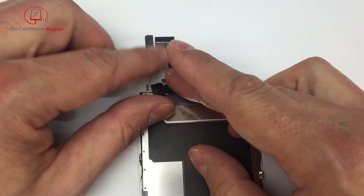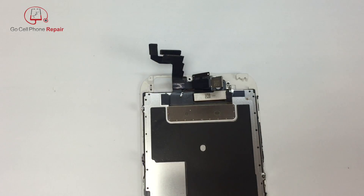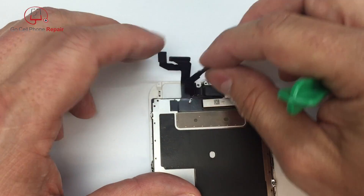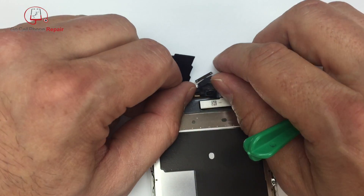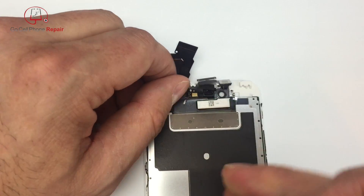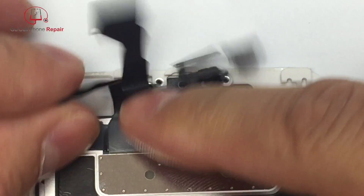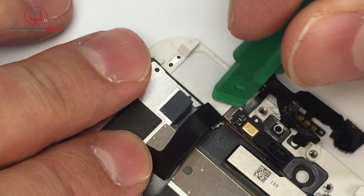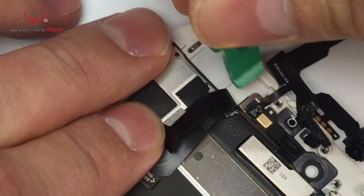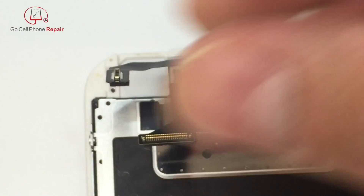Now you can fold the camera over to the left-hand side. Do be careful with these cables. There's an earpiece right below that, so you can take the speaker out, but the next steps require care because the adhesive here is a little bit tricky. Peel it over to the left-hand side and maneuver the cables to get to the microphone, which is that little gold box on the bottom. Be very careful to pry it because there is some adhesive between those two cables. Once you fold it up, there's a very thin cable on the left side — get underneath it and work your way across until you release the adhesive, then peel the whole piece out and set it aside. We're going to reuse that later.